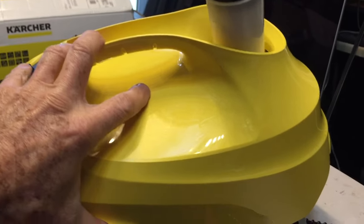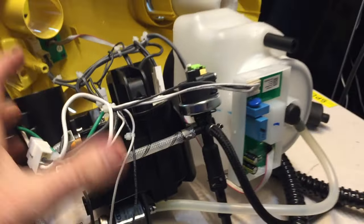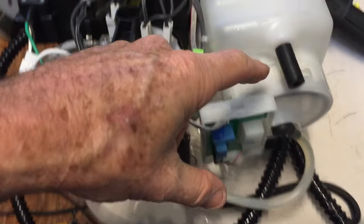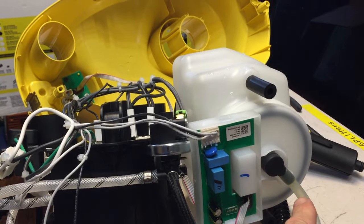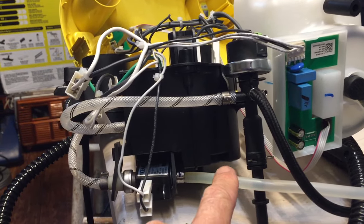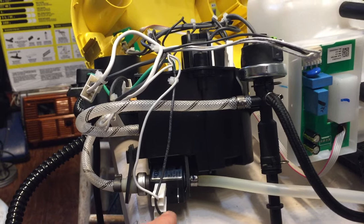I went and tore it down further. What I noticed was that it had a heating unit right here on top where water had to come in from the tank. As I looked the tank over, I noticed there was no water coming out of this hose here even though the tank was full — no water was going into the heating unit.